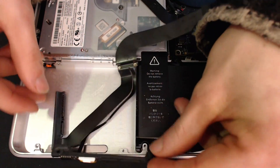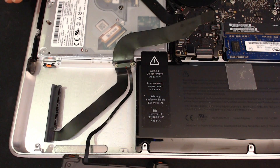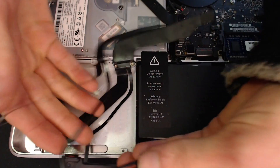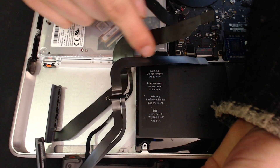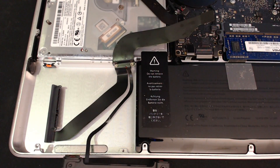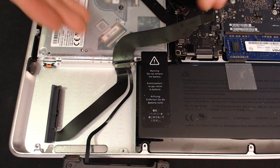You can buy these cables on eBay. The current going rate is about £15. There are two variations of it. This one has a wide ribbon cable; the other variation looks like this — it's got a much thinner ribbon on it. Although the wiring on them is exactly the same, the two are not compatible because the length of the ribbon is different. This one is a shorter length, and the thin one has a longer reach. As a result, you can't fit them interchangeably — this one won't reach, and the other will have too much slack, fold over itself, and break.